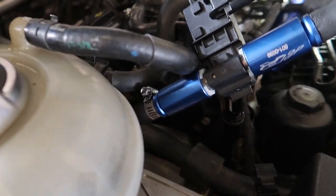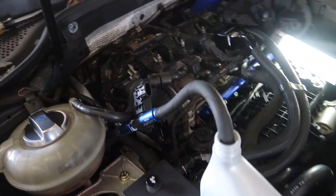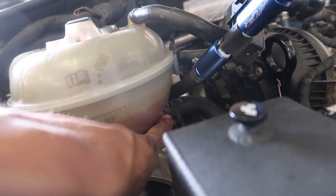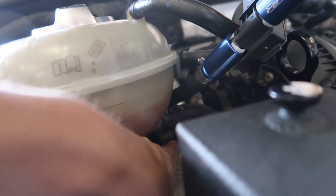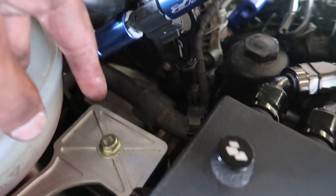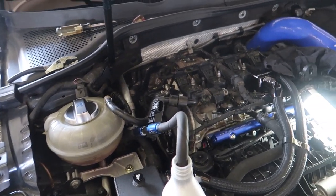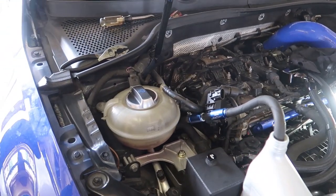We've been measuring, measuring, measuring. Got the ethanol sensor in and we're sending fuel into a container of oil to purge this line. The sensor itself — the middle of the sensor — will sit right at the clamp, right in between there. It should sit pretty nice. I'm still going to throw a zip tie on it. It'll snake down around into the clamp and then into the fuel rail, so it shouldn't be too much in the way. I still have to run the wire over and go get a fuse.